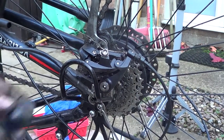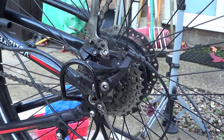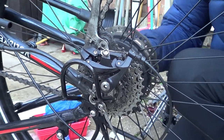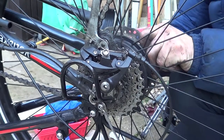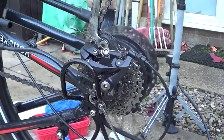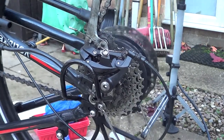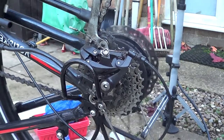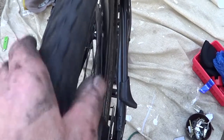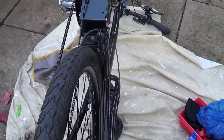The other side also has a plastic cover nut on it, and I've got the nut over here ready — just a question of doing the same thing. Then just see what the wheel looks like. It's not too bad actually — it does move a little bit, but for an older bike it doesn't true too badly. We've got the wheel back on and it runs quite true really — I'm quite happy with that. We'll now put the bike the right way up, blow the tire up and come back.